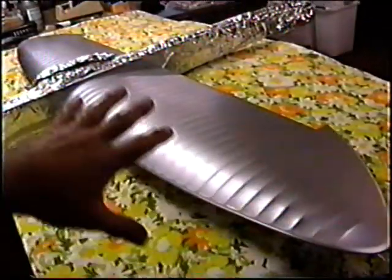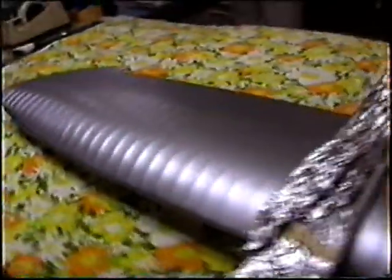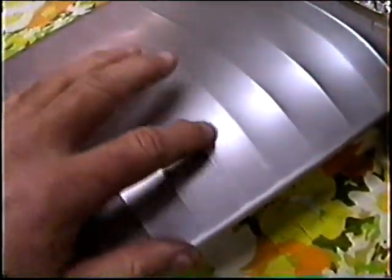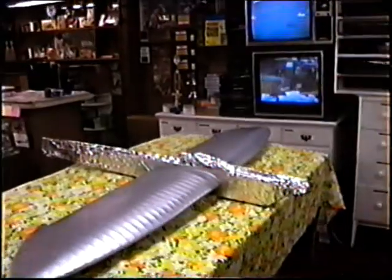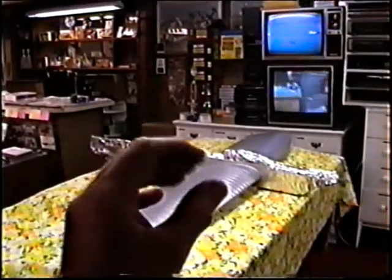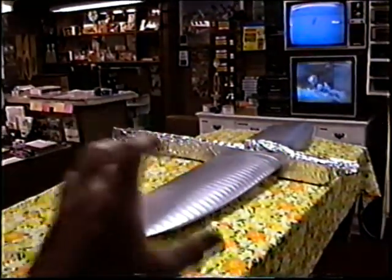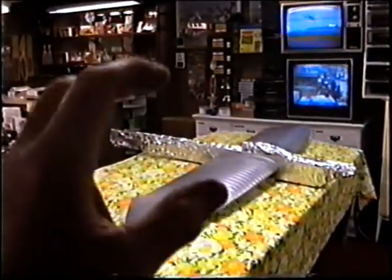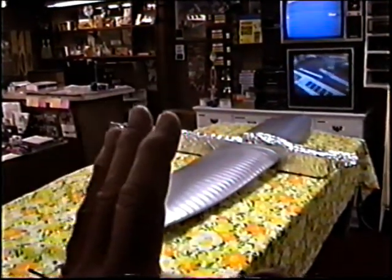When that's laying there on the floor and the lights are shining or sunlight, very important, you will see the little mistakes. So I'm going to get the 1200 paper in seconds very, very carefully. Now from this point on, it's extremely careful not to just gouge it. I want my fingernails trimmed. I'm really getting to the point where I'm happy with that coat of silver. And I want to make sure I don't sand through in any spots. I'm going to be very, very careful.